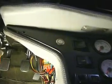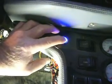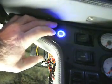Now we see that the push button is flashing, which indicates the engine is ready for starting, and we can press the button as many times as we like to start the engine. We don't have to turn the key on and off again, which is a big advantage in a Pantera. I'm going to purposely not allow the engine to start — you can still see it's flashing, telling us it's still ready.